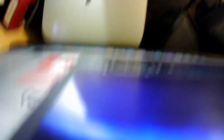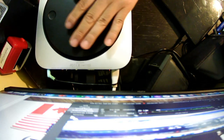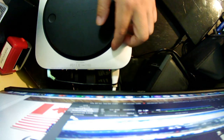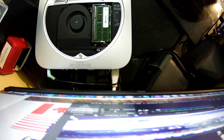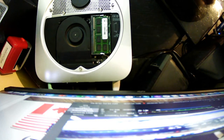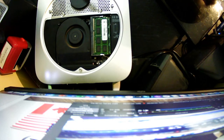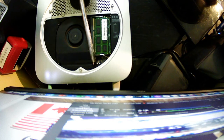Let me show the Mac Mini here. So this is my Mac Mini. If you turn it upside down, there is a black cap on it. Gently open it counterclockwise. You will see the fan is running. There is the Wi-Fi, and there are several screws. There is also RAM and additional screws in there.